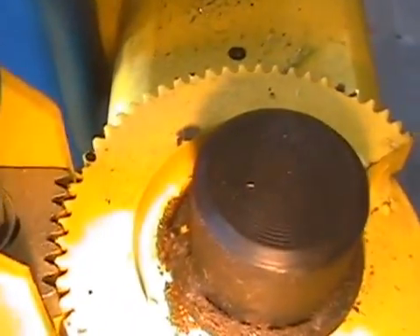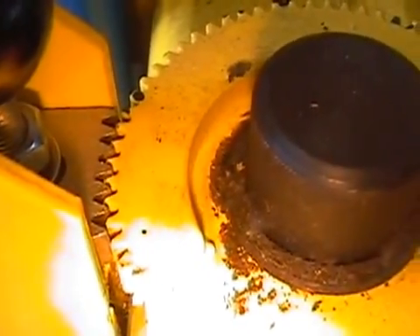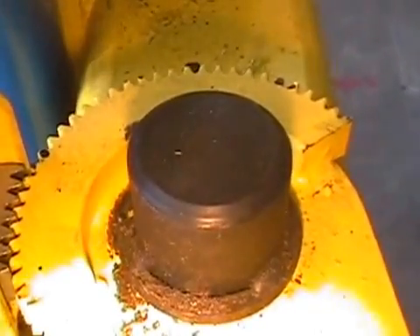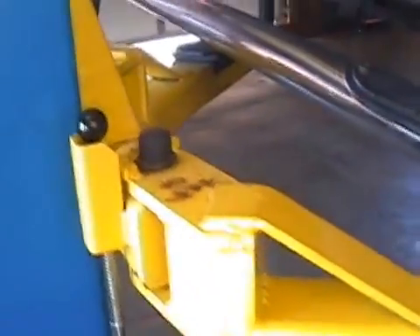You'll notice that the teeth of the gear are right in contact with each other. That prevents the arm from moving while you're working on the vehicle. Sometimes you have to tug, pull, and push to get a part off, so you want to make sure all four of those are secured in place before you perform any task. I've already raised the lift past the safety and then lowered it back down on the safety. We're at a good working height for the front wheel bearing.